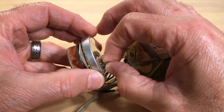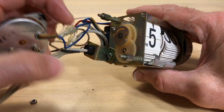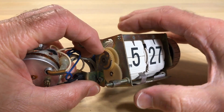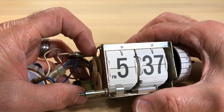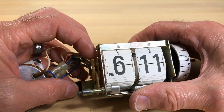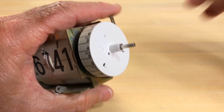That gears the motion down to a certain rate of spin, and there's a lot of mathematics involved. This thing here contacts this wheel, and that wheel turning directly turns the minutes. But indirectly, through this gear coming down and back up through another gear, it's turning the hours at the same time. So the one spin rate that impacts here is geared down so that it makes a full turn every 24 hours for the hours, and every 60 minutes for the minutes.